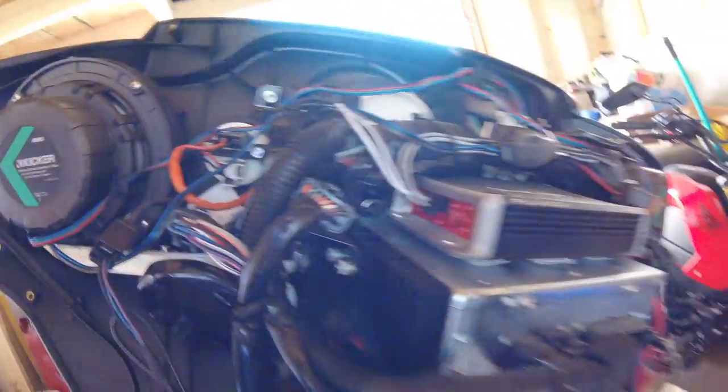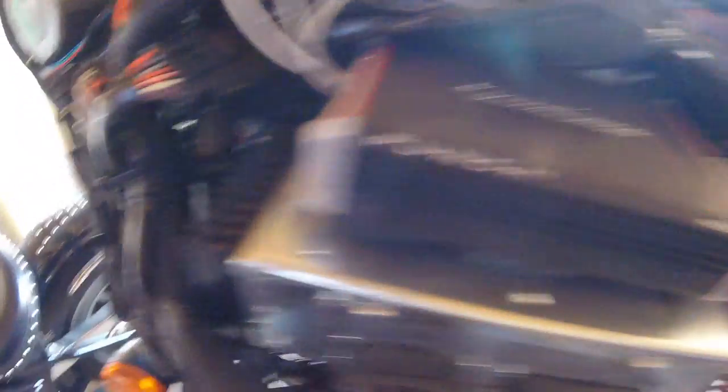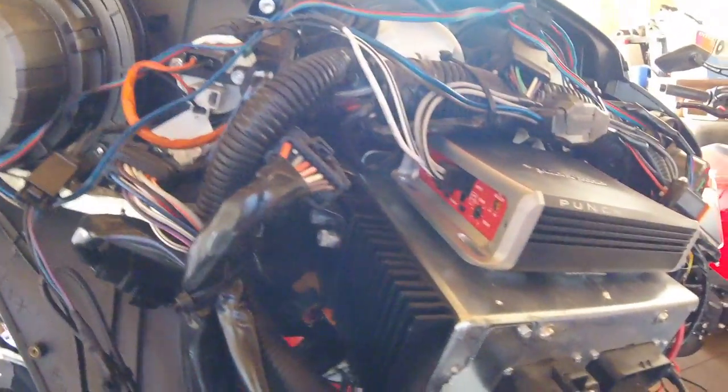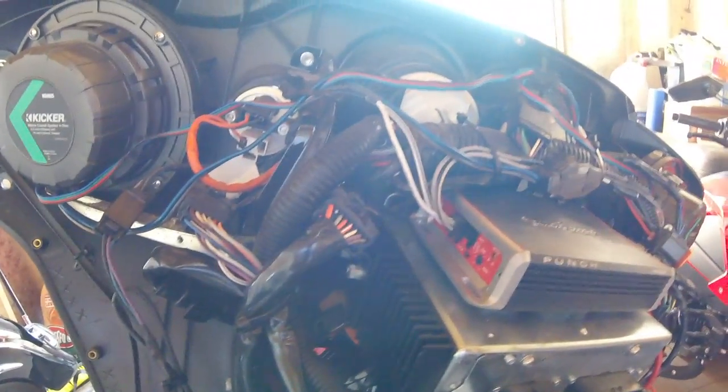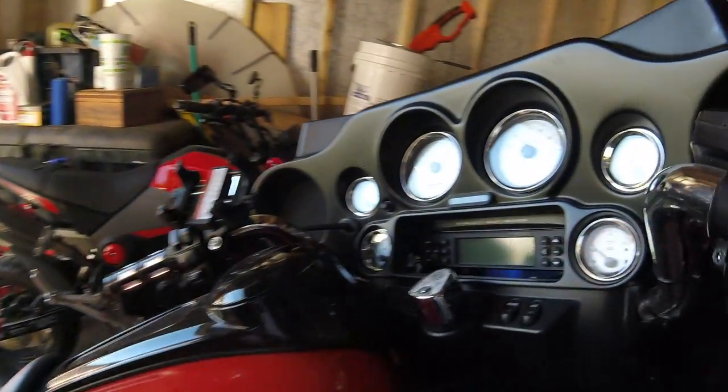To make this easier, I'm going to pull my stereo out — not all the way, just enough to slide it back so you can run the cord for the auxiliary cable. You've got those two bolts right there, the antenna plug, and two more over there. A little time consuming but not that difficult. Once you undo those bolts it'll slide out; there's enough slack to pull it out and create a gap where you can run the cable through.